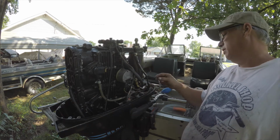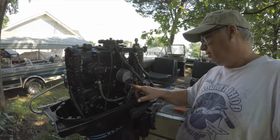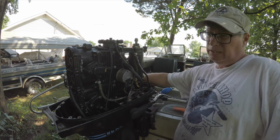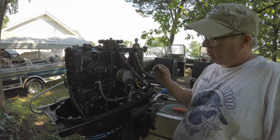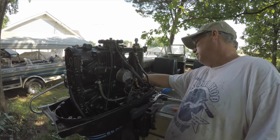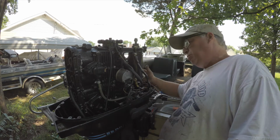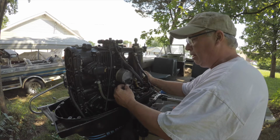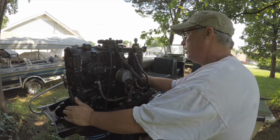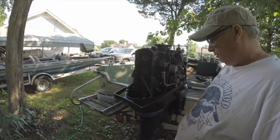So if I can get the switch box to fire, then this will send the high impedance signal, I guess it's high impedance, where it steps this up, but it should hit the distributor over here, and you have a rotor and a cap. So lots of things in the line, you know: your trigger, your switch box, power pack, it's over there, power pack, switch box, coil, and then your distributor rotor and to your spark plugs, or as Cody Bass calls them, candles. So they kind of are.